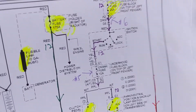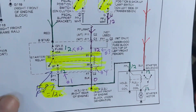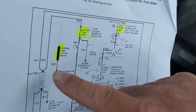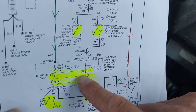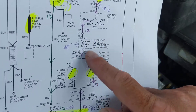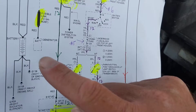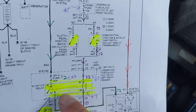We're going to look at the starting circuit and how to troubleshoot it. I'm in front of the fuse panel and I have a meter that I'll show you in a second. This is the diagram — let's go over it quickly. There's a main relay right here. When you turn on the ignition switch to the start position, current flows through here and activates the coil — I call this the input. Once that happens, current flows and closes the switch to terminal 87.